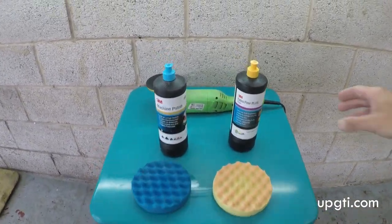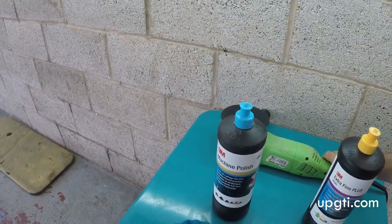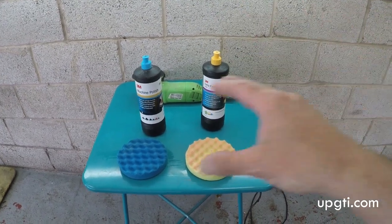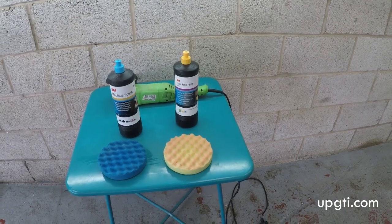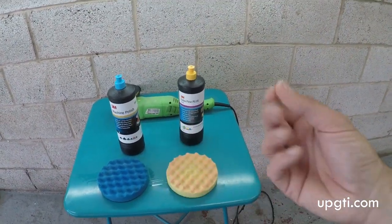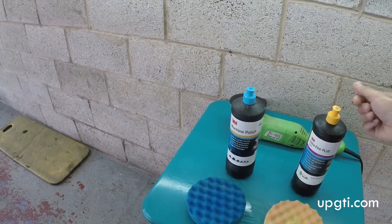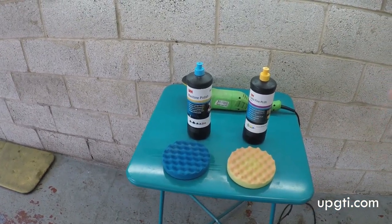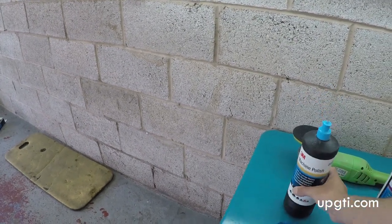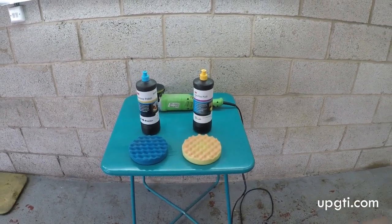This is what I use for machine polishing. The most important thing of course is the polisher itself — this is made by Dodo Juice, it's called a Spin Doctor. I think I've had it for about two years and it's been faultless. But it's pretty useless unless you have the right compounds. For years I've always been using the 3M system, which is various different grades of compound and pads that will bring paintwork up from being really scratched to absolutely gleaming — a bit like using different grades of sandpaper. You start with the harshest and gradually work your way down. Today we'll only be using yellow and blue. The yellow is extra fine plus — barely any abrasion, but it will get rid of any imperfections and bring out the colour beautifully. Then the blue is 3M machine polish which just brings a shine out. And then we're going to use Autoglym HD wax as a final finishing step and the car should look beautiful and be really well protected.